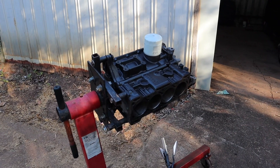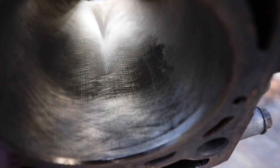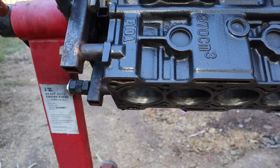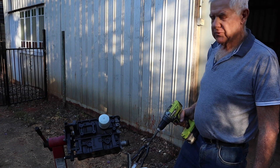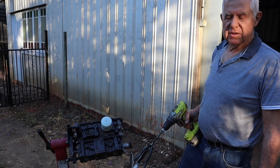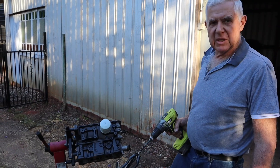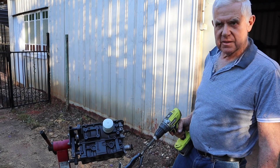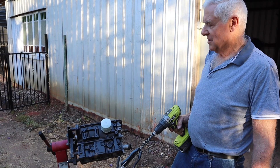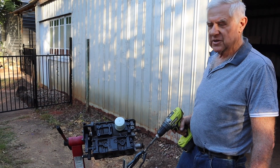Clean rag again, which is not so clean anymore. We've done the other three bores now, so all four cylinders have been honed. There are different ideas on honing. The main idea is to make the rings bed in to take the shape of the cylinders. And other people will say that there's a theory that the oil lays in the hone marks and actually helps lubricate the top ring as it's running in.